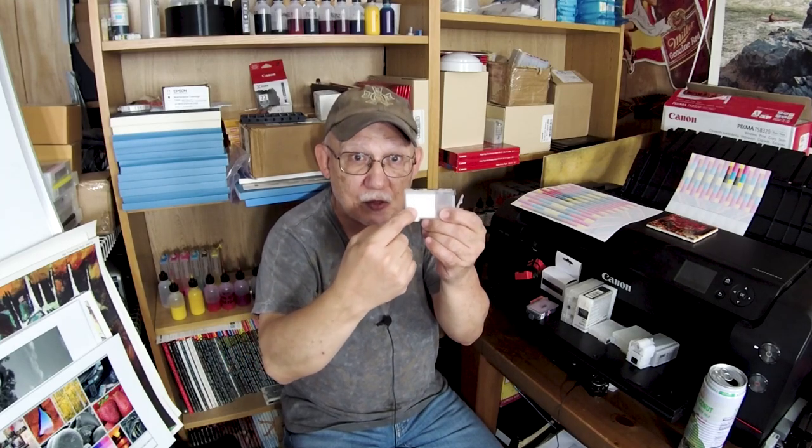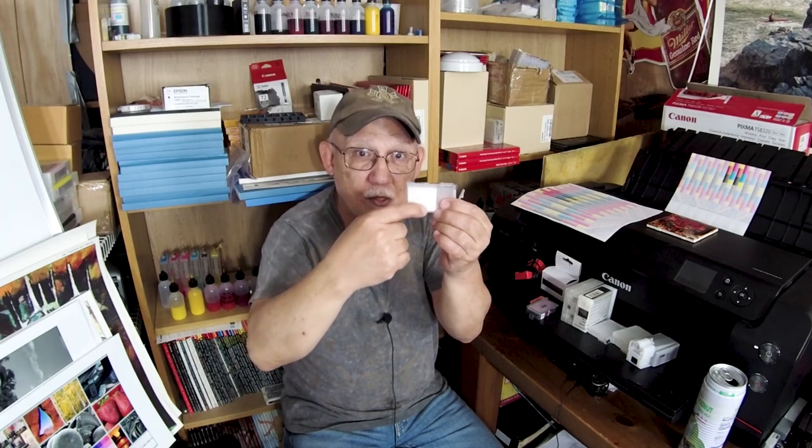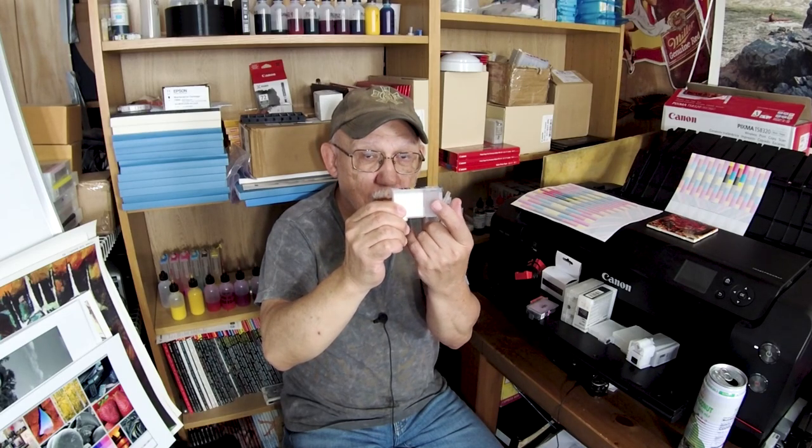The sponge, as you are printing and creating a deficit, is being replenished constantly by the liquid side. So this saturation level pretty much remains constant. You draw some ink out, it drops, and you replenish and it comes back to the normal saturation level. But if you go beyond empty on this chamber — meaning low — and you continue printing, you're going to draw ink away from the sponge. When you draw ink away and there's no ink to replenish it, air gets in. We don't want air in our sponge, because then the reabsorption of ink will be diminished.